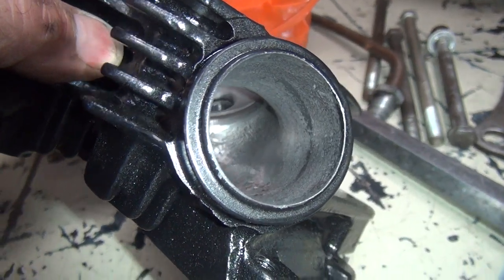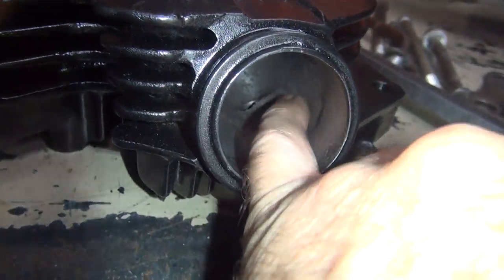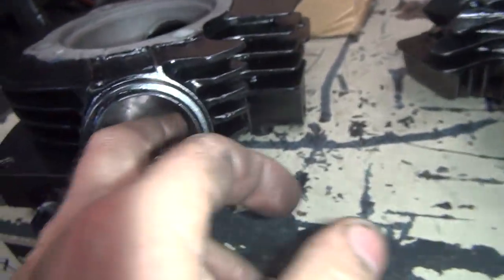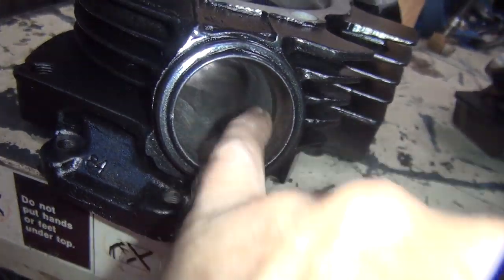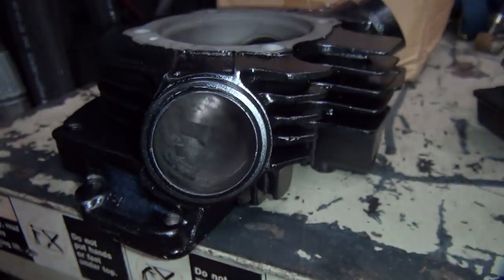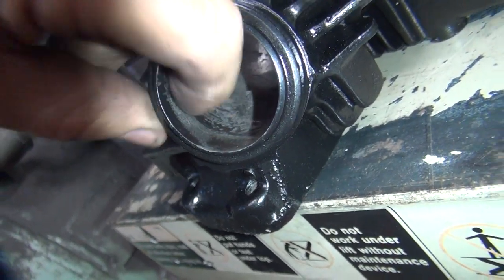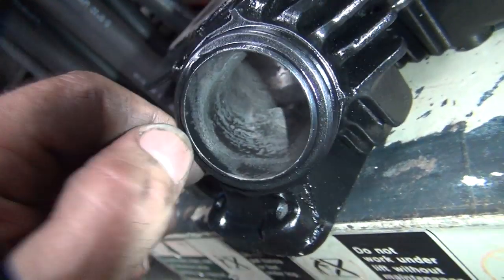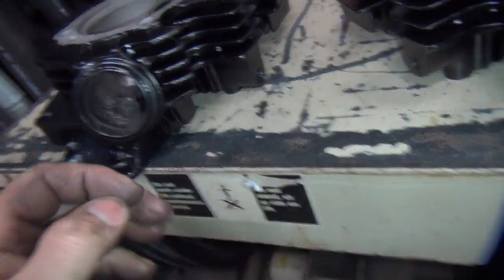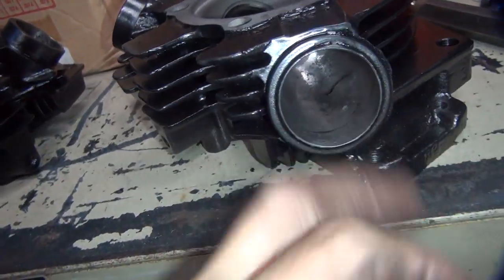The exhaust — you can see the port, you can see the same thing. It's nice and straight and true. You can see how there's not a bunch of waviness in there. We ground out the high spot that was all through here. We had a big ledge like it went over like that, so we cut all that out. That's in here a little bit already — you can see how we initially cut it more, but you can see how it's still in there quite a bit. You see how it humps in real bad through here — we'll cut that all out and blend it all the way up over to here. This side here is undercut real bad, so basically you just taper it from this edge in a little bit so you don't have the funnel where it's going that way and the port goes that way.